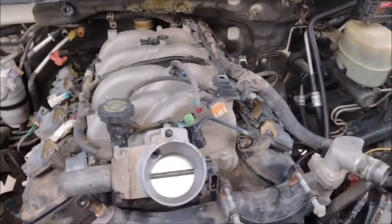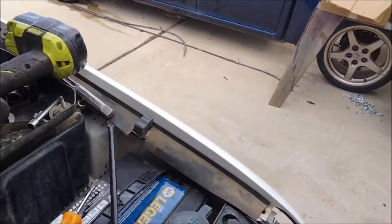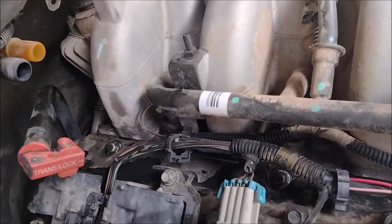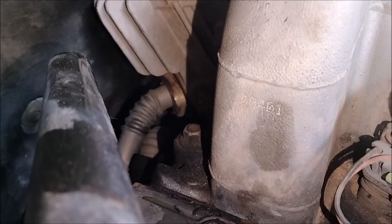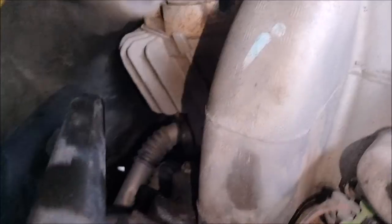To do an intake on your 8.1 with EGR, there are just two 10mm bolts that hold the tube going into the EGR cooler. Use a short 10mm quarter-inch drive in the front and a long one in the back — that saves you hassle getting it all out. Once you get the intake off, especially if you're deleting it, it's two 13s that hold that whole assembly together.